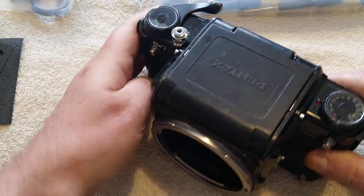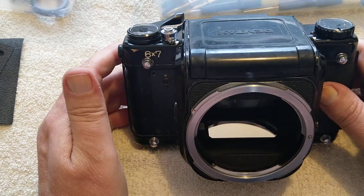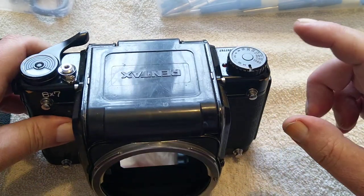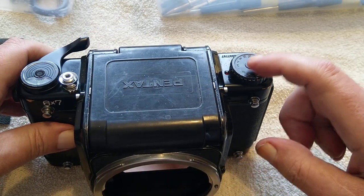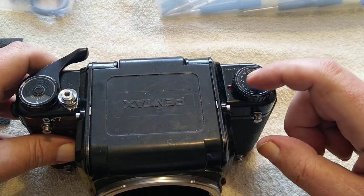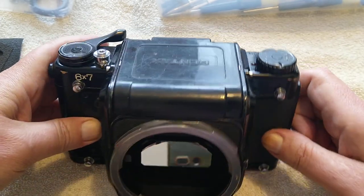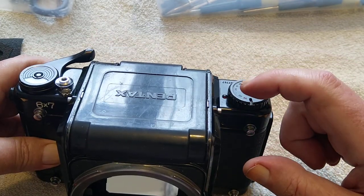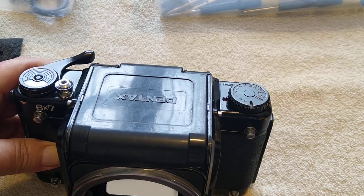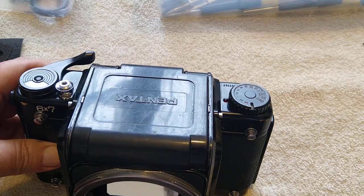So to solve this problem — it's basically an electrical problem. We've got power but it's not doing what it should be doing. The first thing we do is we're going to clean the contacts underneath this switch here, which is the shutter speed selector switch. We're also going to clean some contacts hidden behind these panels here. To start with this one at the top, there are three screws that hold these in — they're normal flathead screws, although you'll need quite a small screwdriver to get in there.